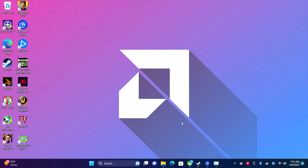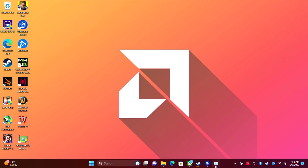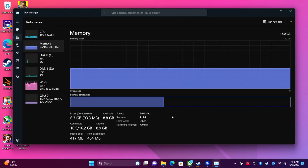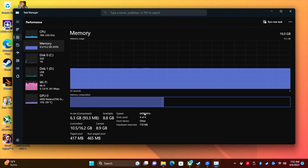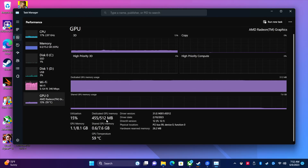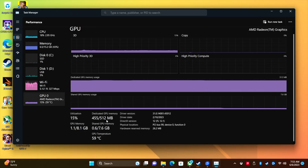I've been using this little PC for two days making this video and I'm super impressed with the size versus the performance. We've got the 6800U, 8 cores, 16 threads, with 16 GB running at 6400 MHz — much faster than other mini PCs with the 6800U that use SODIMM RAM running at around 4800 MHz. That faster RAM really helps the iGPU. From the BIOS we can set VRAM up to 8 GB, but I've got it set to auto because with some games like Hogwarts Legacy, setting it to even 2 GB prevents shader compilation — setting it to auto fixes that.